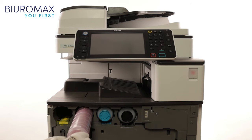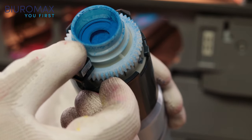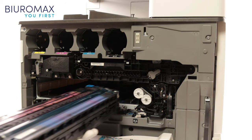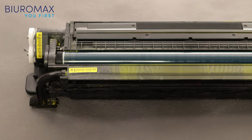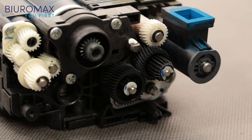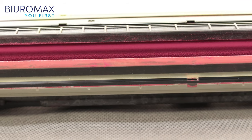Removal of compatible toners for chip inspection. After 18,000 copies, minimal dusting was found on the chips, but this dusting must not affect the proper functioning of the chips. Disassembly of drums and developer units in all colors. Slight dust on the housings is characteristic of all MPC-3503 series copiers and does not affect the proper functioning of the machine. It is important that the imaging unit drives are in good working order. Compatible toners mixed with the developer do not create additional resistance. The magnetic brushes align perfectly, have no voids and no toner spills.